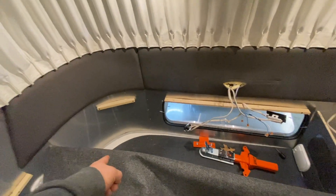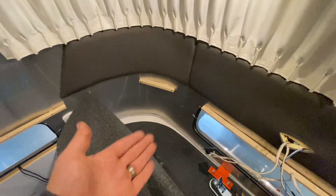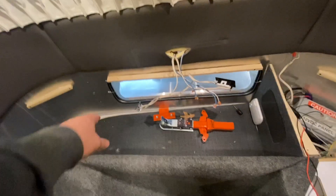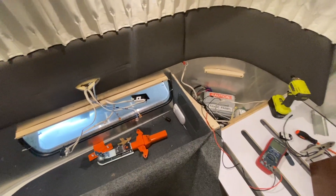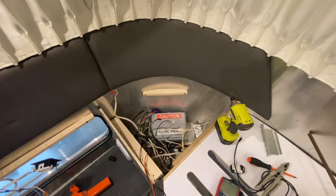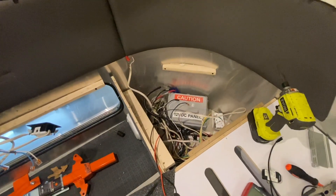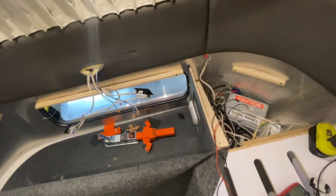There's a little stainless steel cover that'll go over that when we're done. I'll wrap this in conduit and run it to the corner where the batteries are going. I'm building a little platform to lift the batteries up off the floor, which actually gives more horizontal space because of the way the floor curves down. The board will sit right in here, and we'll box it out and ventilate through the same ventilation grate. I pulled out the old inverter and I'm going to use those heavier-gauge inverter wires as the main DC feed lines, extended to the board at the Lynx Distributor.